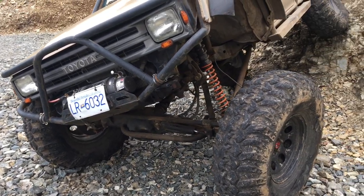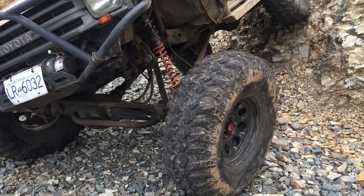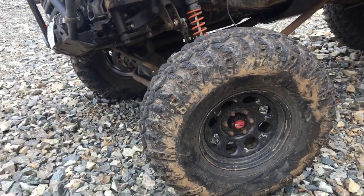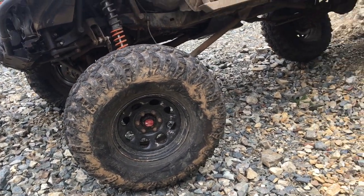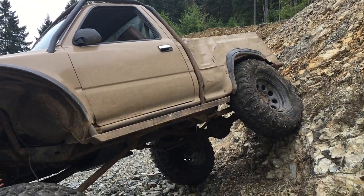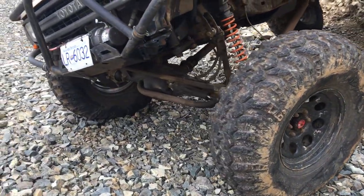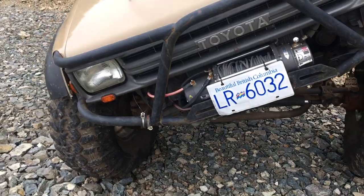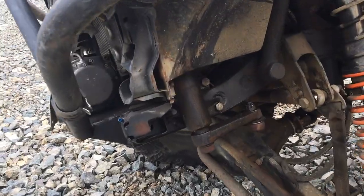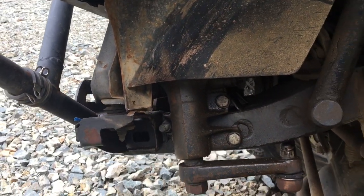The factory hub studs have been pretty good. I run IROCs, I try to keep things pretty light. I like light rotational mass — I feel like that's a good recipe if you're going to run forties. As you notice, I don't have stickies. I'm avoiding going to stickies because I'm pretty sure I'll start blowing stuff up all the time. I still have plenty of fun wheeling stuff and still have tons of challenging spots. Flat pitman arm and then frame's all gusseted.